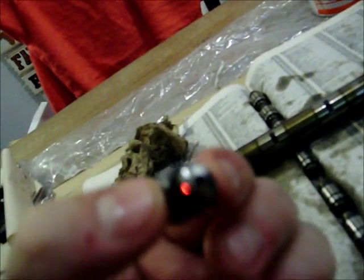And this is the rail. The oil comes in through oil ports. These holes in the middle here are for the bolts to hold them in. The oil comes in and comes out here. This pressurizes the lash adjusters. And there's a little spring inside in the plunger, and the oil comes in the top and pressurizes them.